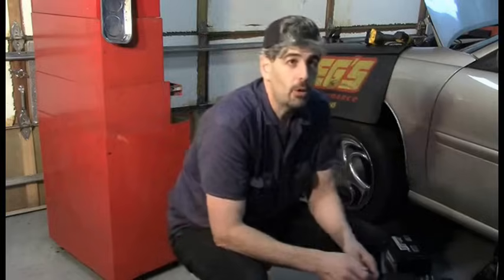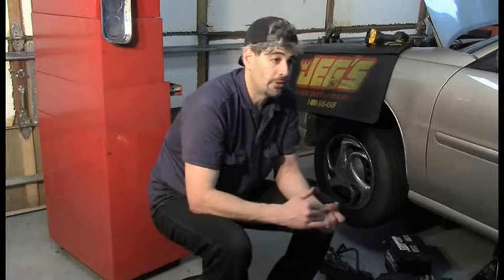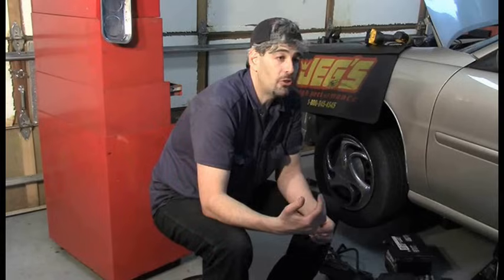Hi, my name is Matt, and today we're going to work on this 1999 Chevy Malibu with a 3100 engine. It has a check engine light with a P0113 and a P0111 intake air temperature sensor codes. In this video, I'm going to show you several ways to diagnose your air temperature sensor to see if you need one or not, both using a scan tool and without a scan tool. We'll also talk about what the IAT — the intake air temperature sensor — is and why you need it. So it should be pretty easy. Let's go ahead and get started.